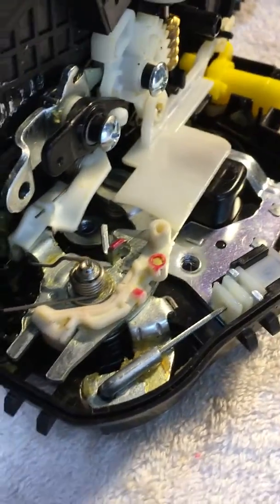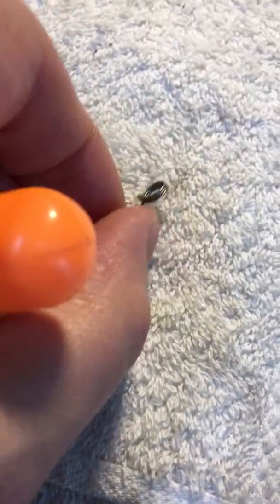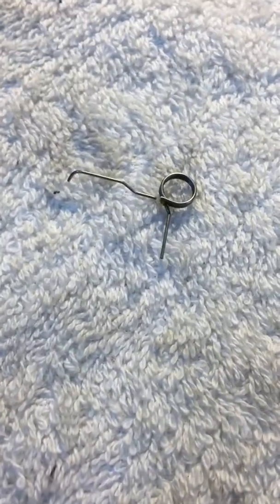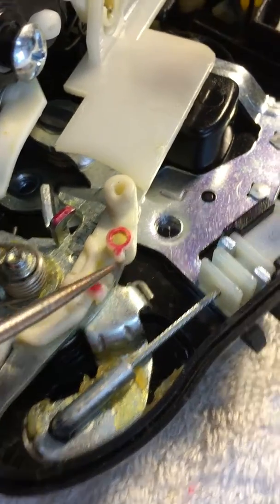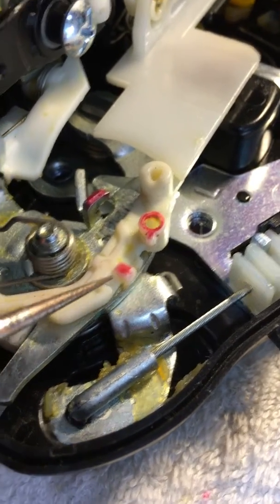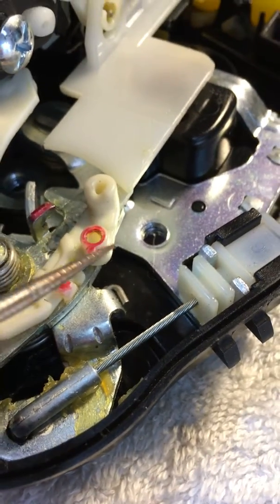Here's the guts and here's the culprit. You've got a mechanism here that has a spring, and this is what the spring looks like - if it was not broken, that would be the shape of it. The way it sets up is: the inner diameter goes around this post here, one leg goes to a little tab that secures it there, and then the other leg goes up underneath this hook here. I've got them marked in red to highlight them.